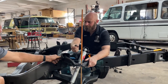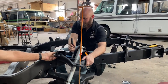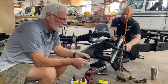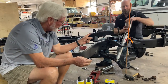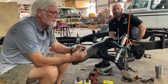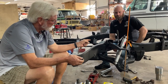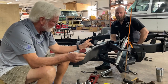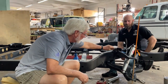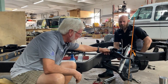If you are going to do this job, you can buy new adjuster bolts, but the new adjuster bolt is soft steel. If you turn it like he's doing, it'll rip out the hole. If you have original eccentrics that have a little raised part like that, cherish them. Spooge that thing down real good, get them loose, and reuse these. On this frame we're doing, all parts are new except for these — these are better and we want to use those. Don't throw everything away; keep it all until the last.